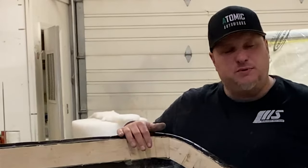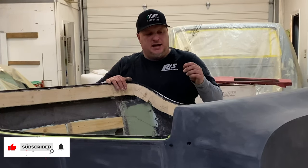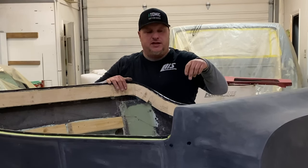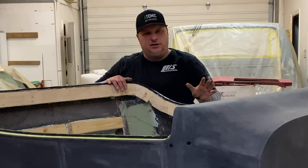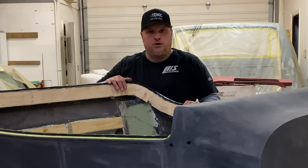For the old-school style interior kits on this one, you have a big nice roll that you pull over, and I'm putting a tack strip into the top here. The reason I'm doing it now before we finish the body work is we used to use nails back in the day. Even with screws you've got to be careful — if they hit a knot they can bend or break. With nails you just have to shoot outside of the car, so you really want to do that before your body work whenever possible.